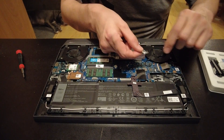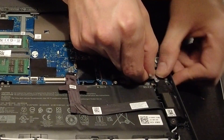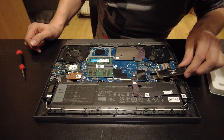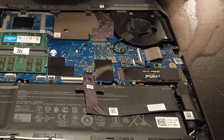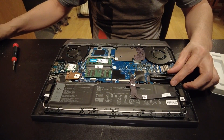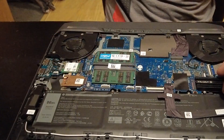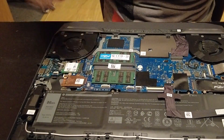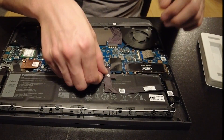To put the new mount on, slide it up into place — the tabs will go underneath and it clips right in. Then take the M.2 drive, slide it into the port, and attach the screw. It doesn't appear there's enough room for the heat sink; I noticed when opening the package it's labeled only for desktop use. I'll monitor the temperature and buy a lower-profile heat sink if needed, like the one on the existing drive. After this, plug the battery back in and reattach the cover.